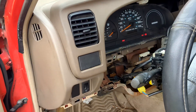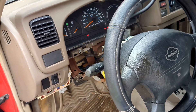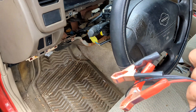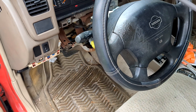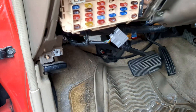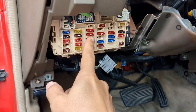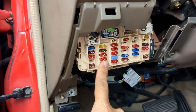I can't recommend this as a fix, but how it fixed itself was we took one of these probes — you connect this to the positive and negative end of the battery, and whatever you touch in the car it will determine whether it's a ground connection or a hot connection. On the interior fuse box, as we're going through here, we noticed that a lot of these were in the ground position when off.